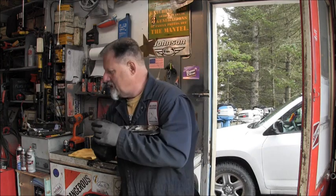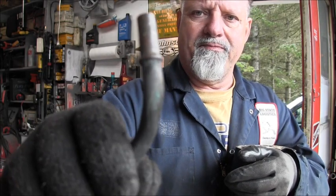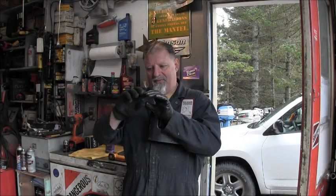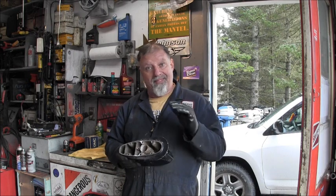Because what you will do is, as you keep banging on it, there's a flange, a flange that the water tube is stuck in from the top down. There's a flange there, and then the grommet. And if you keep banging, you'll bend that flange up straight enough to bang the water pickup tube out of that hole. The whole thing will come out. And yes, you can kind of stick it back up in there, but that's not the proper way of doing it.